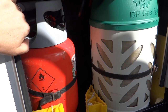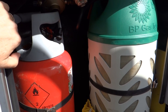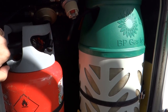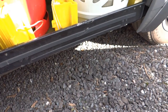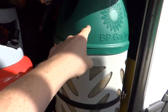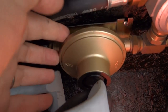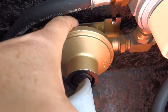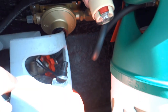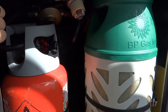This is our current setup. We've got a couple of lightweight gas bottles that have to be refilled by someone else — ones you can't refill yourself. This is a 2001 Hymer B544 on a double floor, which creates limited space around the skirt for where we can put the filler unit. I'm going to have the 11kg bottle here and the 6kg one here. I had to buy a 6 and an 11 because the regulator for the van is right there and would probably get in the way of two 11s. GASIT's pre-sales guys recommended the 11 and 6 combination based on photographs we sent them.